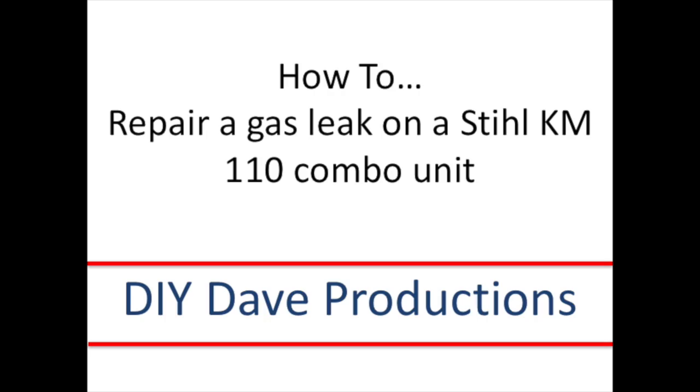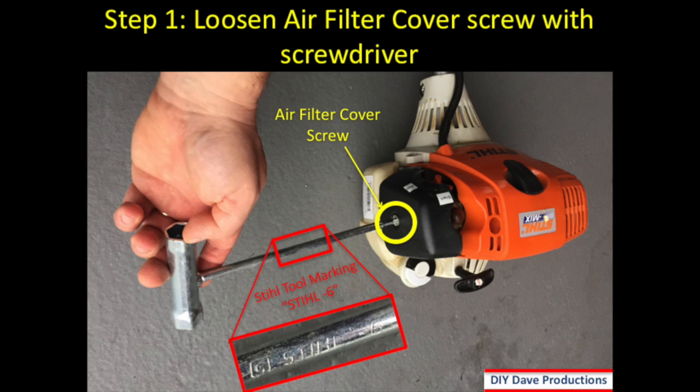DIY Dave Productions presents How to Repair a Gas Leak on a Stihl KM110 combo unit. Okay, the first step is to take the air filter cover off, and you do this by using the tool that came with the unit that has a screwdriver head on it, or you could use a normal screwdriver. But this one says Stihl 6-inch, and you use that, unscrew that screw, and then you'll be able to pull that off.